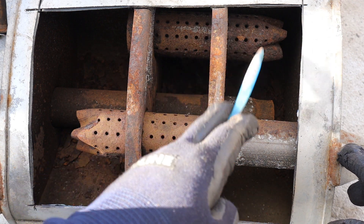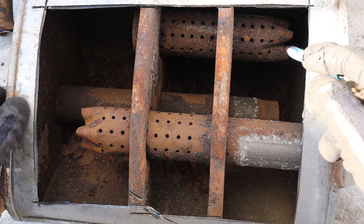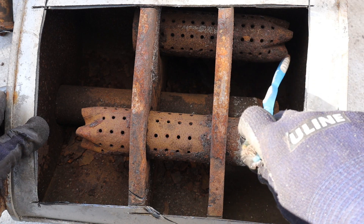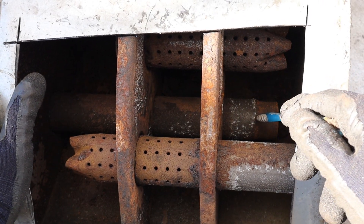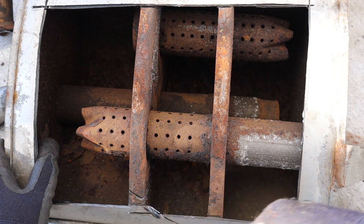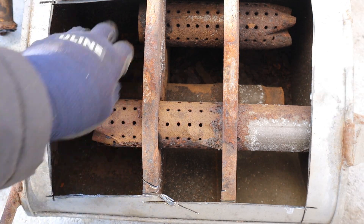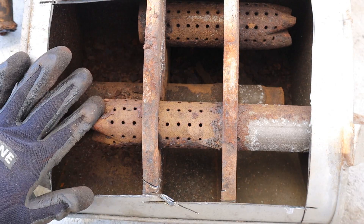That exhaust gas travels over to the rear chamber. In the rear chamber, this pipe is also pinched just like the front pipe — not completely locked off — allowing some exhaust gases from there and the perforations to fill up the rear chamber. The sound bounces from the rear wall to the baffle, cancels out, and then goes through the pipe out to the back. That pipe then travels through the baffles all the way to the rear to exit the tailpipe. On paper this might be a better design, however it will significantly alter the vehicle's noise characteristics. It also has a double wall, but the build quality might not be the best — there's a whole pile of rust inside that simply isn't there on the OEM, even though this is a lot newer.